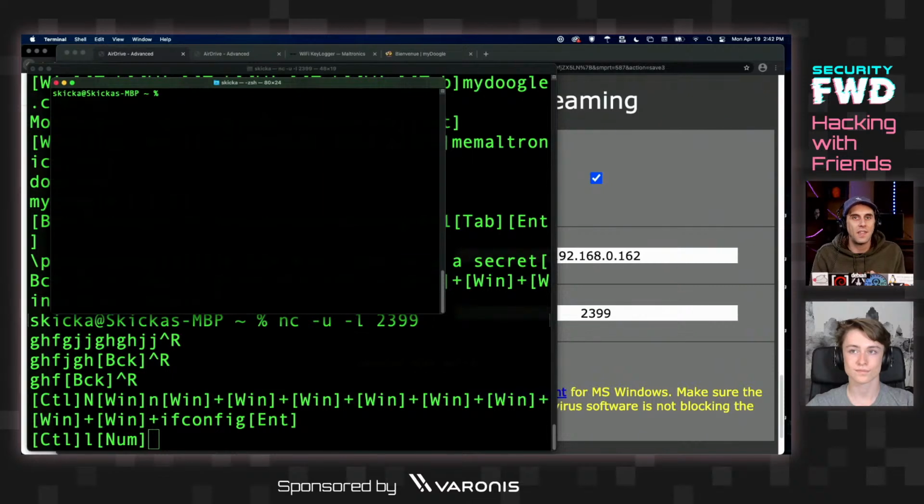Again, this is provided that if you are going after a target, maybe you know the Wi-Fi network, maybe there's a nearby Wi-Fi network, it has some sort of ability to connect the Wi-Fi keylogger to an access point. If you can't do that, then it can't use some of these more advanced features, and you're going to need to use it either in access point mode and come back later, or establish a connection directly to it from a distance, or maybe retrieve it later and download the logs. All those are perfectly valid ways of using it.